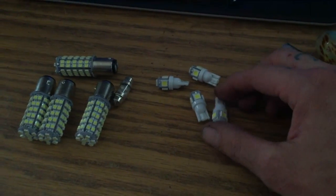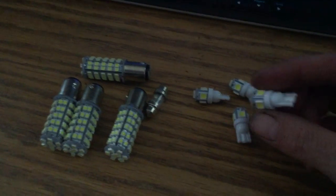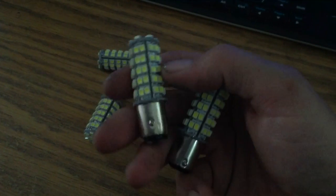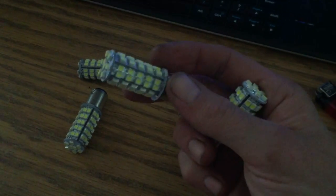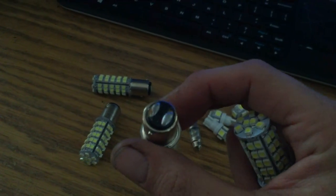These are my front and rear side markers and maybe my license plate lights — haven't figured that out yet. And this is the courtesy light in the dash that kind of shines on the passenger's knees. That one's going in today. These are the two-way LEDs — when your lights are on this is on, and when you hit the brakes these come on. You can tell because it's got two little contacts on the bottom.